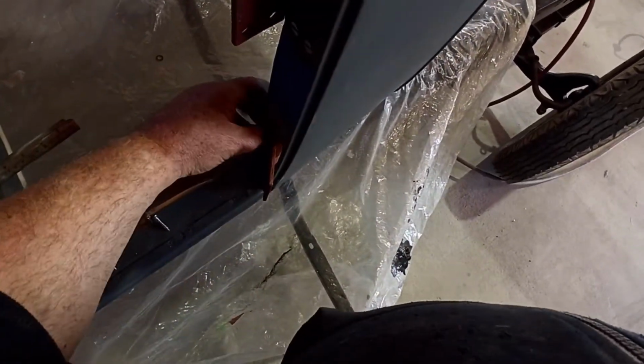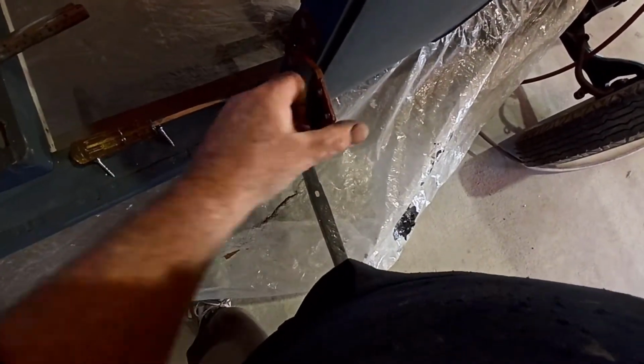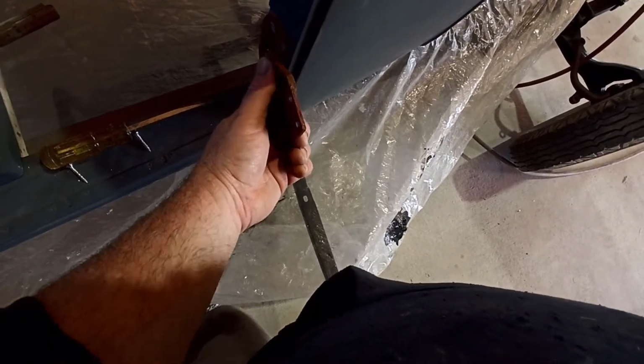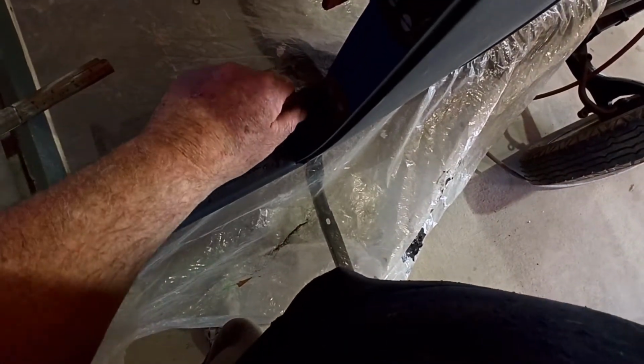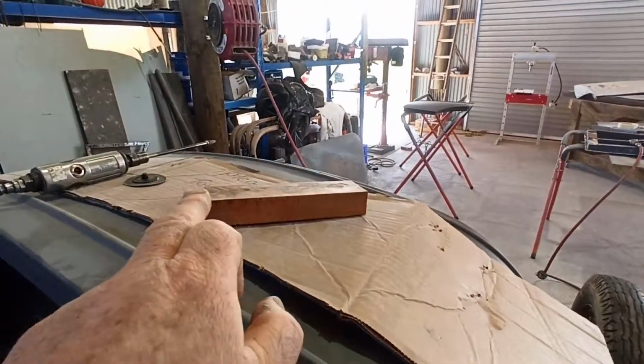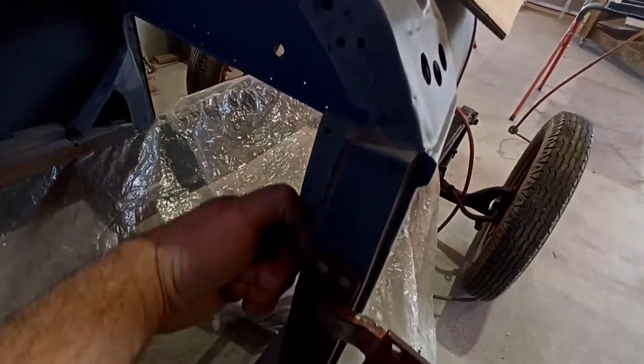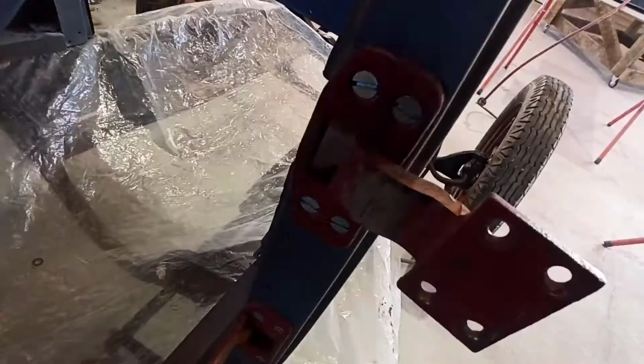What I've actually done is I've relieved a little bit, pulled this around, and I just relieved a little bit of the metal under here, just a touch, and I've just sanded this back off, hardly anything, just to give it a little bit more if it needs it. I probably could do the same on here too, if needed. Just run the die grinder up the back of that, with that nice little fine tip one, just to tick that edge, knock that back edge off.